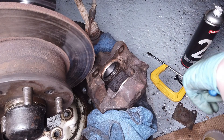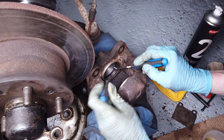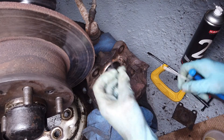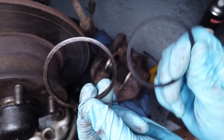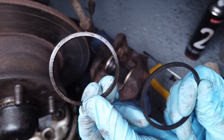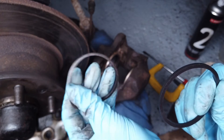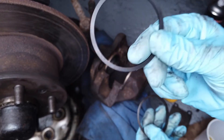I'm going to try and pick out the old seal - two picks might help here. There we go, that was easy. Here we have the old seal and the new seal - spot the difference. The old seal was on the outside face of the piston bore and received a lot of dirt and damage - there's some pitting and other things on it and it's a bit squishy. The new one is a fair bit harder.